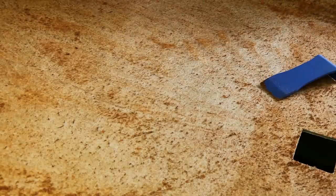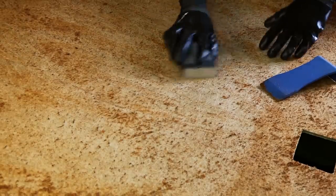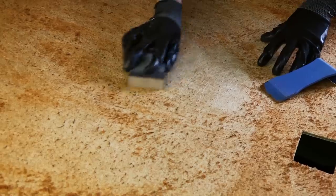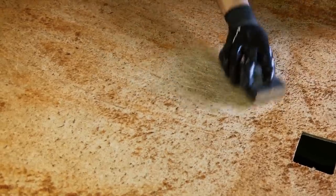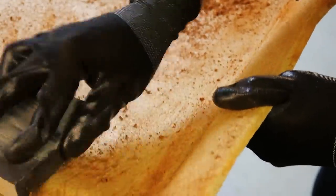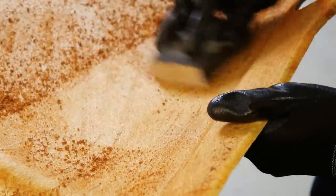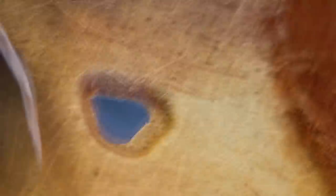Now that we've scraped off the majority of the foam I'm going to get a sanding block and try and sand off the remaining foam remnants. Regular sheets of sandpaper would work just as well but don't get something too coarse — it needs to be a fairly fine grit because the foam is fairly soft. Make sure you get into all the nooks and crevices to remove as much foam as possible, because if you miss a spot it's going to affect how well your new headliner can stick to the existing backing board. A little bit of extra time spent here is well worth it.